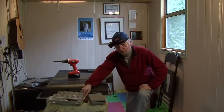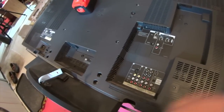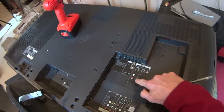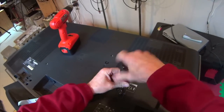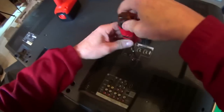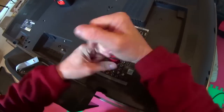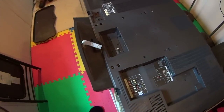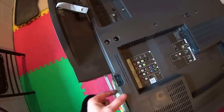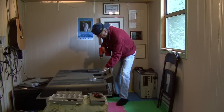So we're going to take off the back cover. One of the first things I wanted to show you is over here — I had a lot of trouble finding these screws. There are two little screws right here, and all the screws that were taken off to release this back cover are marked with a double arrow. All you need for this is a Phillips — a medium sized Phillips and a small one. And there are quite a lot of them.